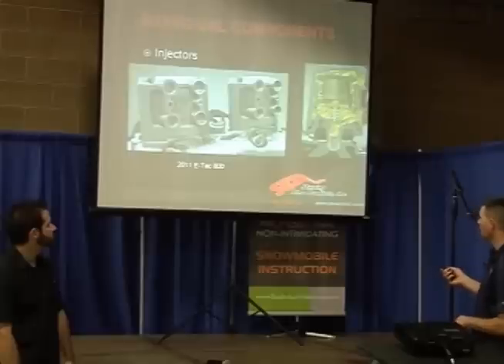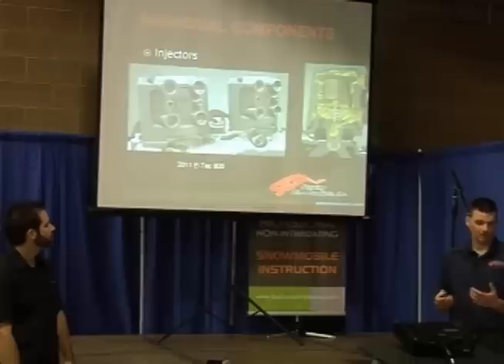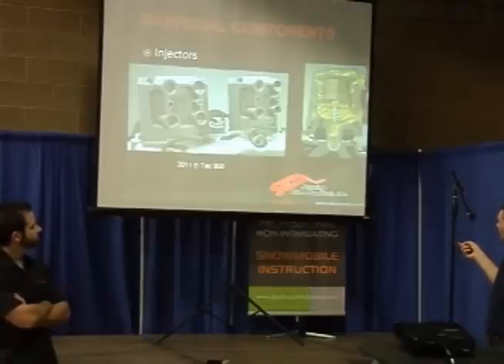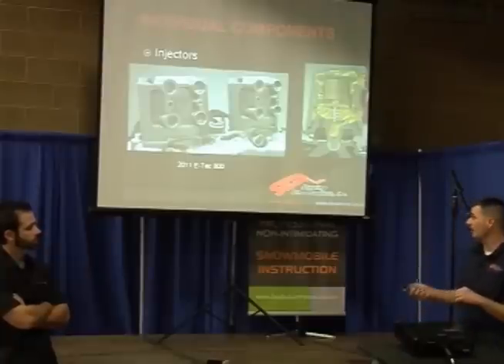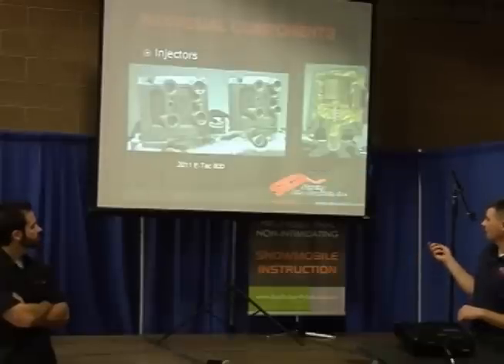The way this injector works is it's a voice coil activated injector. You'll see these coils right here on the side — those are the voice coils. They have a cylinder in the middle that acts like a speaker. A speaker is basically a harmonic frequency tuned into a voice coil that makes the speaker move and creates a harmonic sound — they're basically doing the same thing here. This chamber then moves and pressurizes the diaphragm right here. The fuel is running all the way through — you've got a fuel inlet right here and a fuel outlet. The fuel comes in, runs down here, and fills this chamber. When the voice coil activates, it pressurizes the diaphragm, pushing the fuel through the injector. It is not a mechanical injector — it's activated by hydraulics. The plunger is activated by fuel pressure itself. Whereas in the previous version, those are actually a mechanical injector — there's a rod that opens and closes a valve in the very tip of the injector.